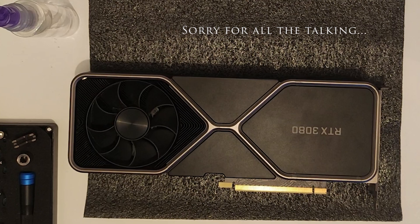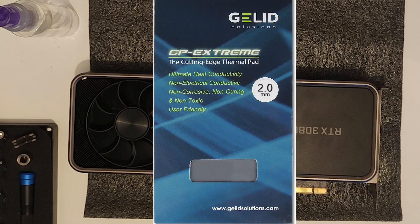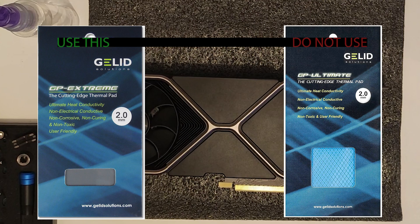The next big thing you need to source is a replacement set of pads. Pre-cut pads for the FE are not yet available so you will need to cut your own. I highly recommend Gelid's Extreme 2mm pads — they are almost perfect, though tweaking is sometimes required. You can opt for the 1.5mm ones as well and many people have had great success, but I find the 2mm slightly easier as you can use scraps from the front pad on the back too. I used two packs of 2mm thermal pads; others have recommended 3mm on the back and 2mm on the front. Do not use the Gelid Ultimate — those are way denser and will not work. Do not buy Gelid 2mm Ultimate thermal pads for this project as they are unsuitable.